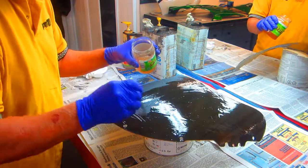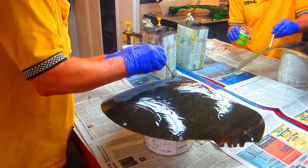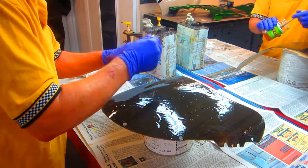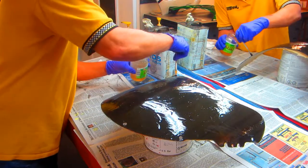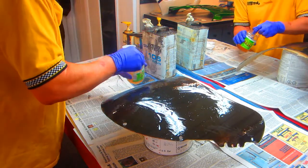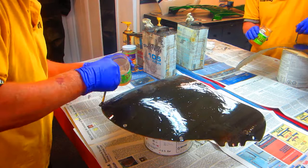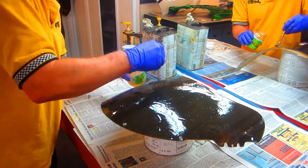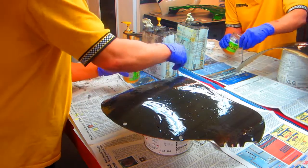Most of the motorcycle stuff is cosmetic. If you're going to try to make a muffler — I made a muffler repair for Ray's SV650 — you'd use Huntsman high temperature resin, same as I used when I made the R1 mufflers. You can laminate over a steel or aluminum muffler relatively easily. At one time I wanted to take a pair of expansion pipes for a two-stroke and laminate over them with Huntsman high-temperature resin and carbon fiber so they looked carbon fiber.